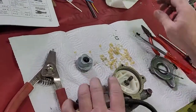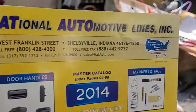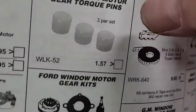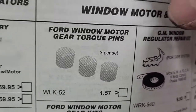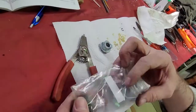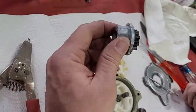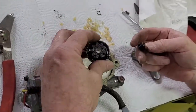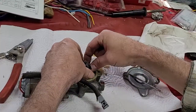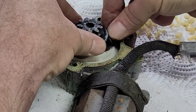For years I've been getting these from a company called National Automotive Lines — they've since changed names and I don't remember what it is now, but there you go: $1.57, Ford window motor gear torque pins. I used to buy them 20 at a time. Get your gear. These are kind of hard to get set in there — you gotta kind of get these set in there cockeyed, like so. They're tough; I don't expect they'll ever break again.